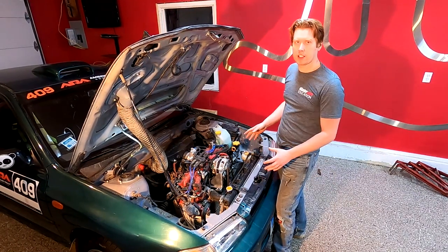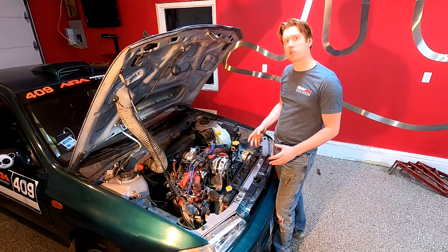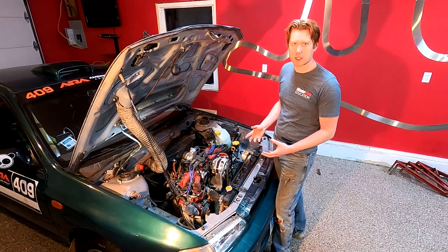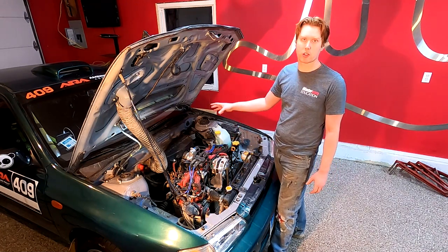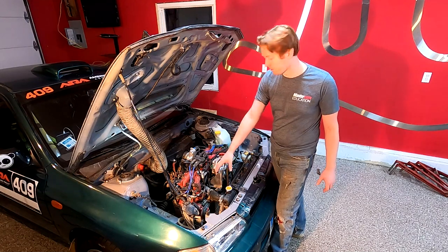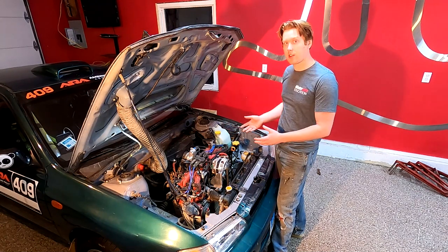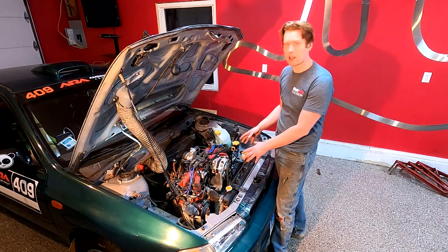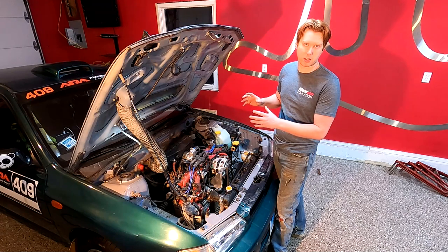For accessory and wire cleanup, I haven't done too much wiring-wise to the engine harness. I want to keep that as stock as possible so if something goes wrong and the harness gets cut, I can replace it without spending hours replicating what I did before. I've eliminated the power steering pump entirely and converted it to an electric power steering setup. I've also taken the AC out on the other side — which is somewhat contentious with my co-driver — so the only accessory I'm driving is the alternator. It's a super simple short belt and we can fix this very easily or toss another belt on and be back on the road within a few minutes.